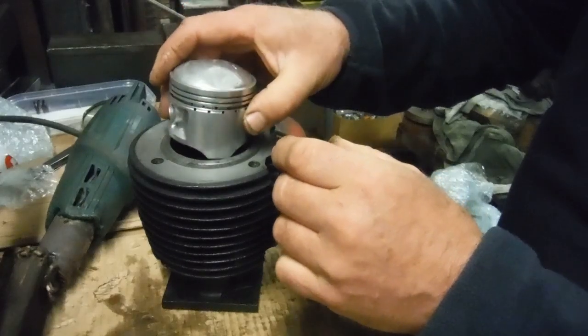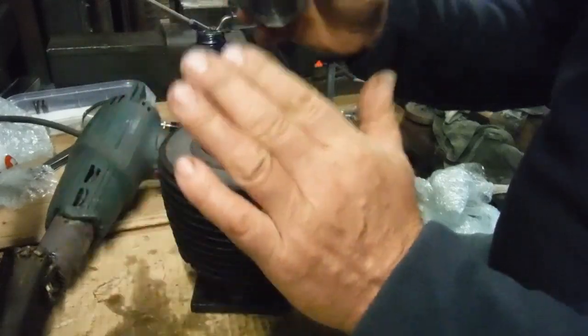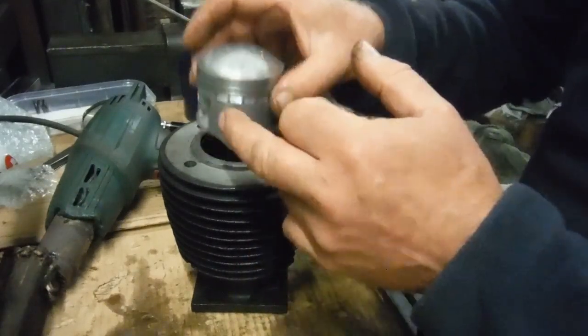So you really need to warm a newly built engine up very carefully indeed. If you want a fast warm-up and to get away quickly, you're going to want a little bit more piston-to-bore clearance. Anyway, we can see: cold liner, cold barrel, cold piston — we've got four thou piston-to-bore clearance measured fore-to-aft on the piston skirt, and the piston drops through quite easily.